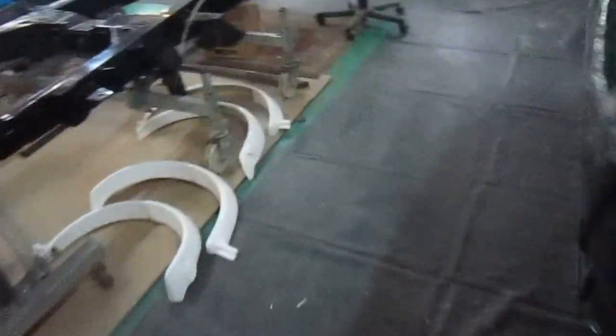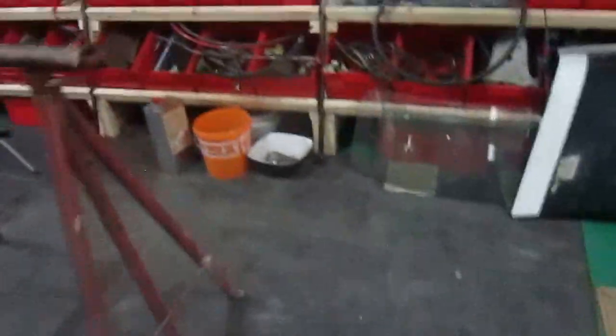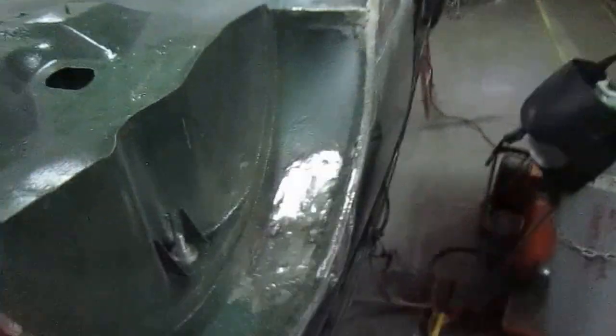On the Mini, we had a horrible patch. In fact, I'll pick up the stuff and show it to you. There was a patch in here which I didn't do until it's only just been done, because I was more worried about the integral strength of it than anything else. You can see where this one is now. We haven't done anything with it, but that's a brand new patch, and we used the English wheel there to roll it to get it to the right shape.